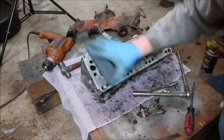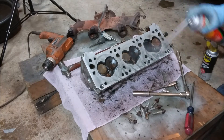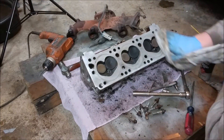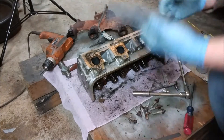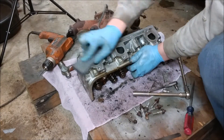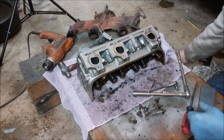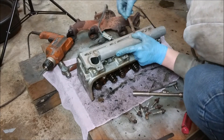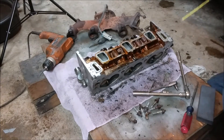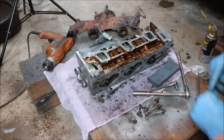Just continuing on doing a second pass — I didn't really need it, it was a fairly light pass, I just thought it could use a little bit more polishing. I hosed it down really good with some degreaser. I'm not really worried about damaging the spark plugs because I tend to replace them when we put this all back together. Most of the surfaces on this one cleaned up really nicely — it only took a couple minutes per section to get them nice and flat. This is another surface we're checking to make sure we don't have any major warpage, because there's a lot of heat on this side. The manifolds can shift on you a little bit, but the other side was just as good with no warp in it. So I didn't think this side would be an issue, but we still check.